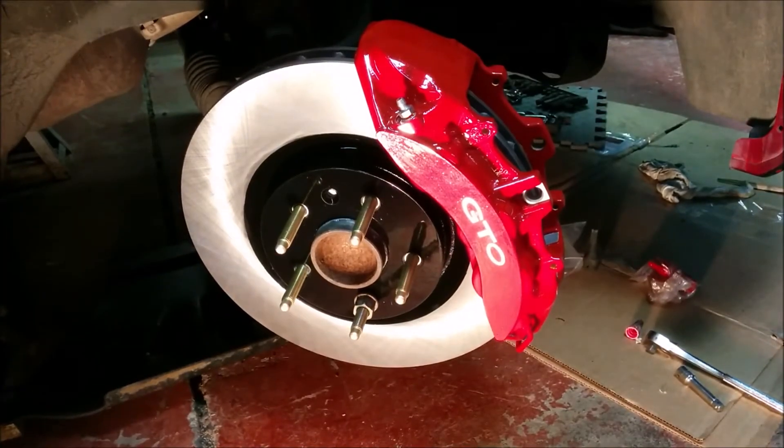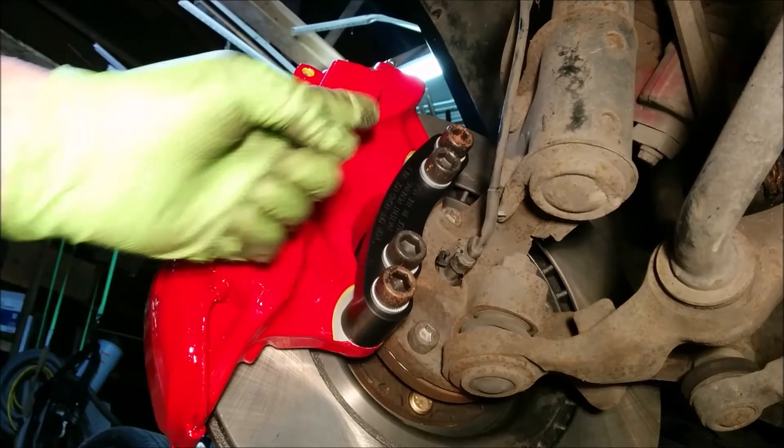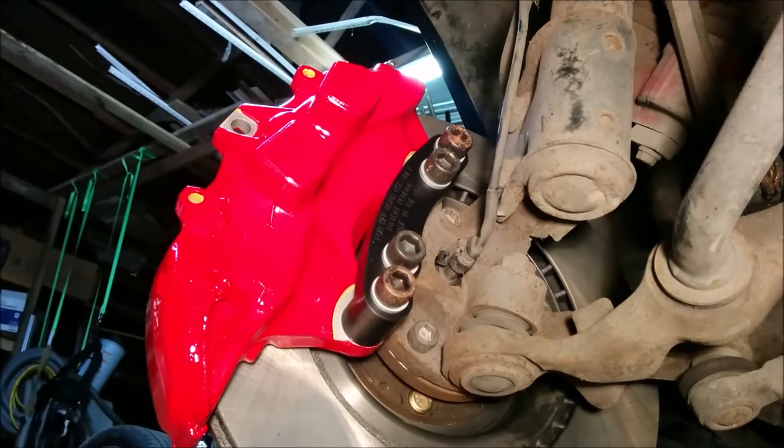Does that look amazing. I'm going to set everything up behind there and do the torquing. Since I hate doing these 90-degree things, I'm going to get it over with and do the middle two at 52 pounds first, and then 90 degrees.